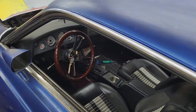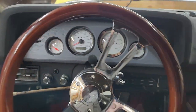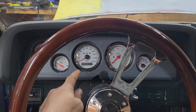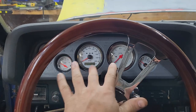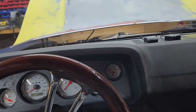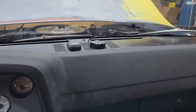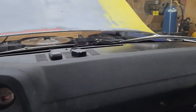We went ahead and got the new gauge cluster in. I redesigned it to give a more optimal viewing angle — I tilted the gauges five degrees forward and swapped the locations so these four gauges are easy to see when you're driving, and you can easily see the ones on the outside just by looking over a little bit. Now everything is ergonomically correct. I also put in the dash pad, and got my two GPS units — one for the radio and one for the actual speedometer — mounted up and hidden in there. The interior is really coming along.